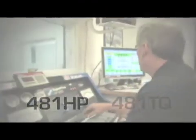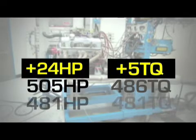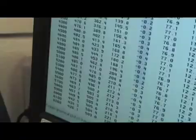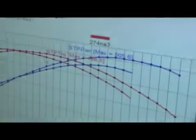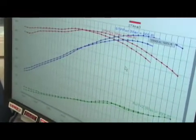Comparing the naturally aspirated run of cam 1 to our second cam, we made 505 horsepower and 486 foot-pounds of torque — a 24 horsepower gain with a little over 5 foot-pounds of torque. With the more aggressive cam, it's not unusual to see about 12 to 15 horsepower increase for every 6 degrees increase in intake duration. We also moved the torque curve up a bit, allowing us to rev to 6500 instead of 6000, with peak power at 6000 instead of 5700. Torque times RPM equals horsepower — if you can rev it a little higher, it's going to make more power.